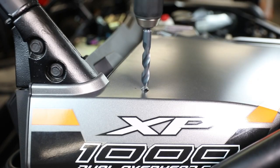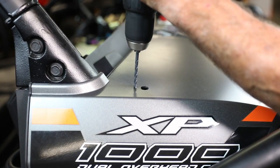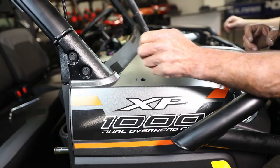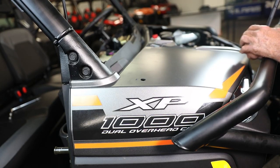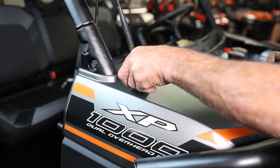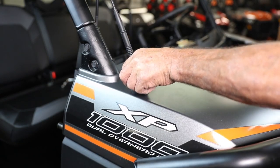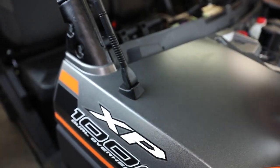You're going to drill two holes: a three-sixteenths or five-millimeter hole for the alignment pin, and a half-inch or twelve-millimeter hole for the mounting post. It's important that you control the drill depth to prevent damage to anything underlying the structure or other components. We have engineered every piece of this system, including the length of the wires and the harnesses, to measure between where the units are mounted and where the antenna is installed.